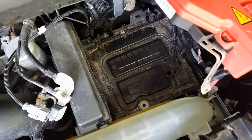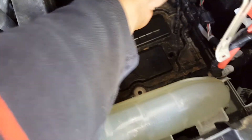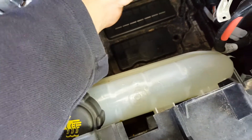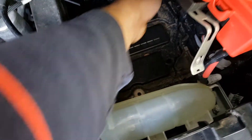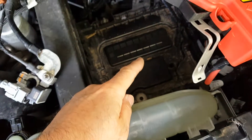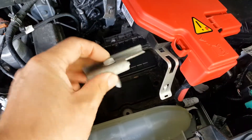As you can see, the bracket holds the battery down and it sits in that tray. There is also a drain hole down here, and here is the drain pipe that goes on to the side of the battery — which was actually disconnected. I would imagine this battery has already been changed before and they didn't reconnect that. It is quite difficult to do, but in this case I also found it was loose.